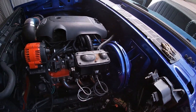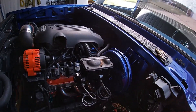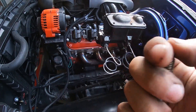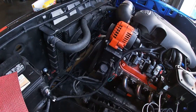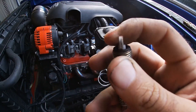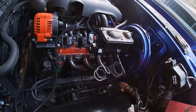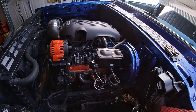Just went and drove it, and the one thing I noticed — this thing's got a miss. When you start to get into it, it starts to break up on top. I got to looking at the plugs and decided to pull them out. Look how wide the gap is — these plugs have an extreme gap. I'm wondering if they came out of the swap vehicle and they just never changed them. I had a set of VR7s, which are a little too cold of a plug for a naturally aspirated engine, but they're better than these. I want to try them in there and see if I still have the same issue. Going to finish swapping them out, go drive it again, and watch the misfire counters on the scan tool.